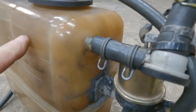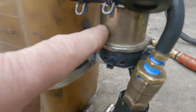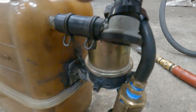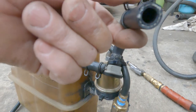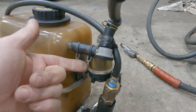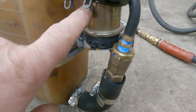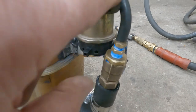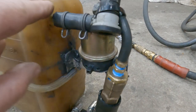Keeps the pressure on the tank. This works on boost now instead of vacuum. We apply boost to this, which is on the other side of the one-way valve. That way when the motor is sucking vacuum it helps pull it closed. So when it builds boost, it pushes it open, opens the valve, squirts it out.